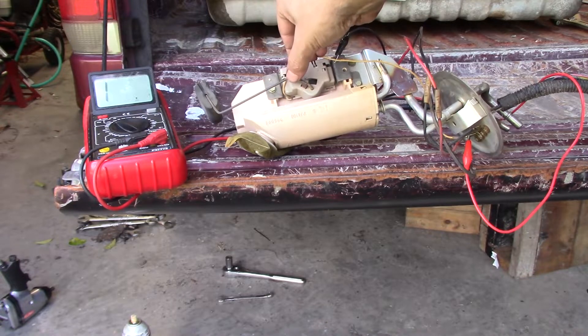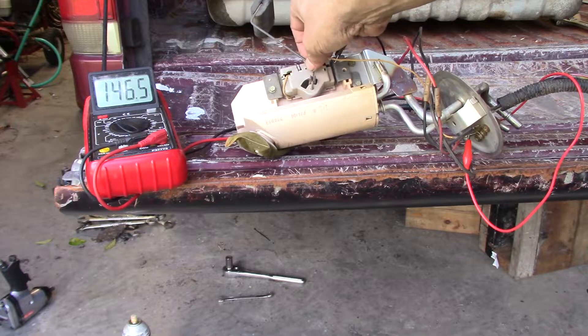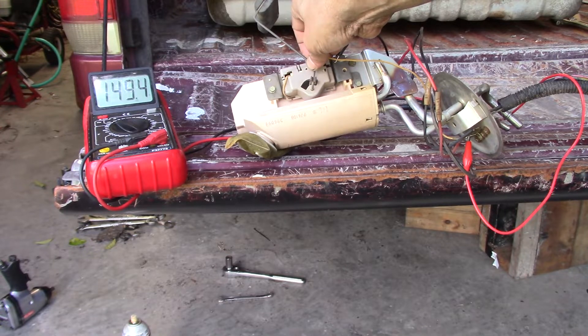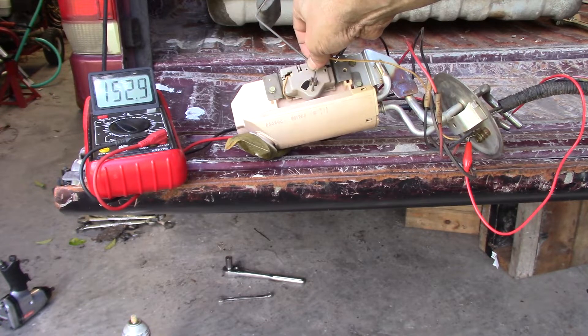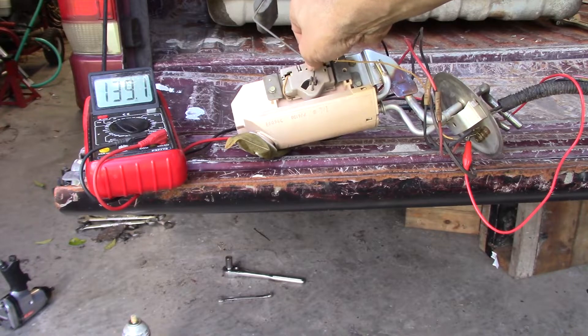This thing, as they call it, is being dicky. It's just not being consistent when I move the arm — it's jumping all over the place. Now the factory fuel gauge will absorb some of that because the movement is very dampened, and that's just the nature of how Ford built the gauge. You can change the reading going to the gauge and the needle doesn't move that very much. So if there's just a little bit of noise on here, that gauge will absorb it.